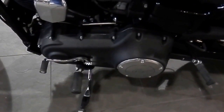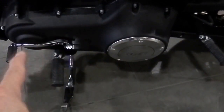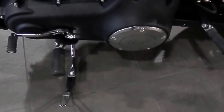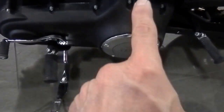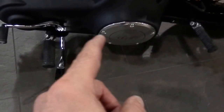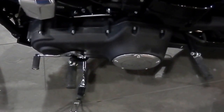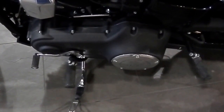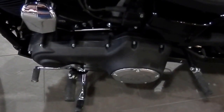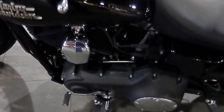This is the primary side of the Harley. You also have another tensioner right down here that drives the primary chain drive between the front and rear drives. This is your rear final belt drive that connects to the pulley, and this is your clutch basket. You have a tensioner you'll probably need to replace at around 30,000 miles as soon as you start seeing wear. It's a much larger tensioner than the cam chain tensioners on the other side, so it has more surface area and you'll get more mileage — but you should change them out periodically at around 30,000 miles if you want the bike to last.